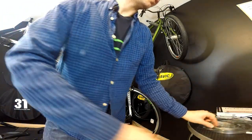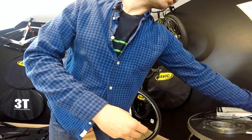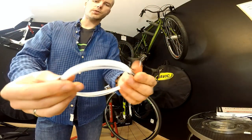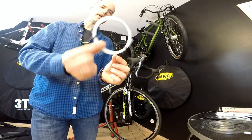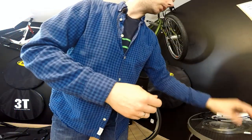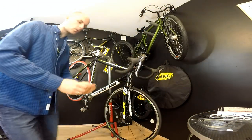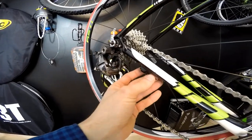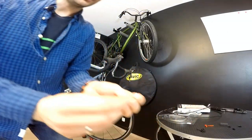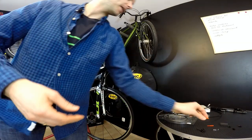So we have the housings and cables, then three standard ferrules — two go into the shifters and one into the rear derailleur. We have long-nose ferrules that come from the cable stoppers on the frame to make the system fully sealed. We also have two grab seals, a short-nose ferrule that goes just before the rear derailleur onto the last section of housing, cable end crimps, and these nice-looking cable end plugs.